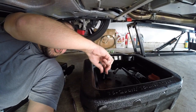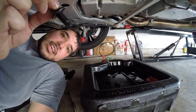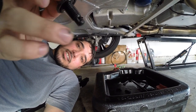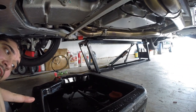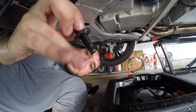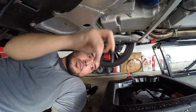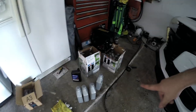So if you guys remember from my oil change video, I installed this dimple magnet drain plug. I don't see any metal shavings — you guys can see there's definitely sludge that has built up at the tip, and that's just over 2,500 miles. The oil itself came out pretty clean; no real concerns. But it's interesting that the magnet was able to capture this — it's probably still from the break-in period since I changed the oil at 500 miles. This is probably just the fine dust of everything getting seated properly, and the magnet is able to catch it before it goes through the rest of the system. A magnetic drain plug is definitely worth it.